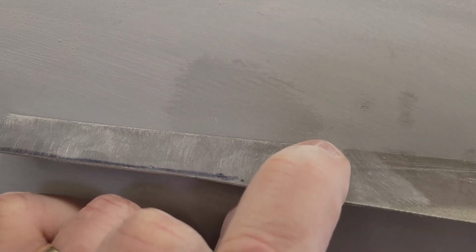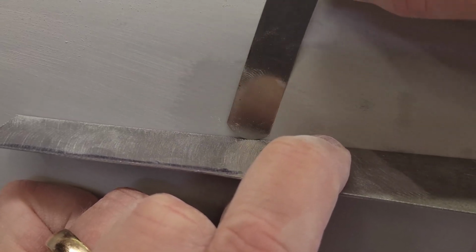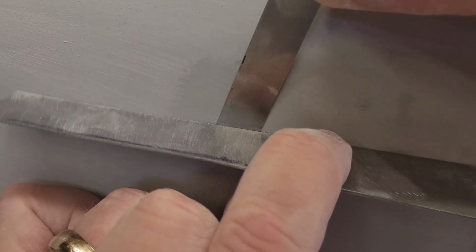Watch, I'm going to put a feeler gauge on that with a straight edge. So watch, I'm right on top of this little divot, and you can see it. You can see how the sandpaper hit the highs, and there's the low. Watch how close this is. I've got a straight edge. Now I've got my feeler gauge. That's 4/1000ths. And it's touching there. And 4/1000ths just barely goes behind it. I've got to work at it to get it. It's like it doesn't quite go here, but it hits right there. It goes through. 4/1000ths. So it's basically 4 mils right here. That's how low that is, but you can see how the sandpaper shows it up. Just wafer thin.